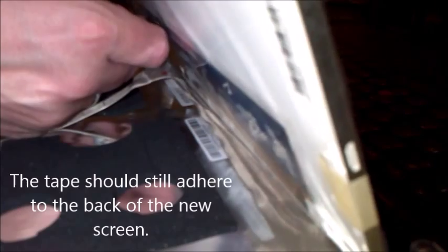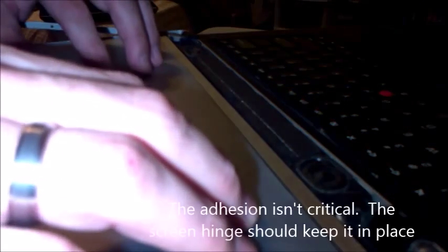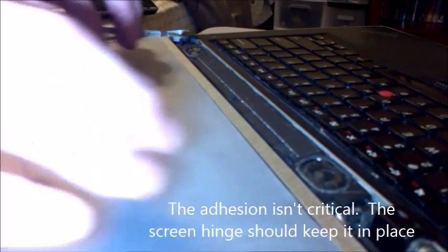The first thing we want to connect on the new screen will be the connector that we took out with the tape. Reverse that process — connect it like you disconnected it, plug it in, and it should snap into place. Lay the tape back down and replace the rest of the tape as you had it previously. If you set the screen down flat, give it a nice press forward and back.